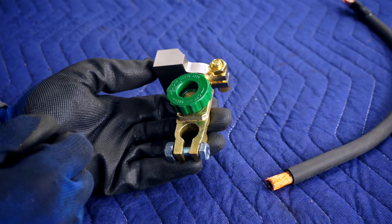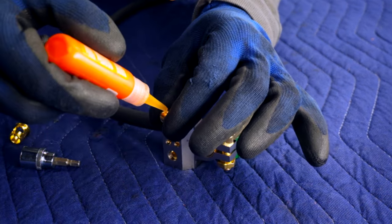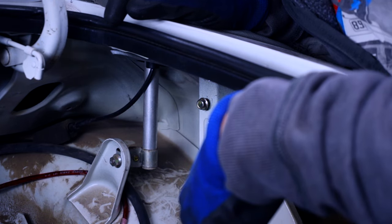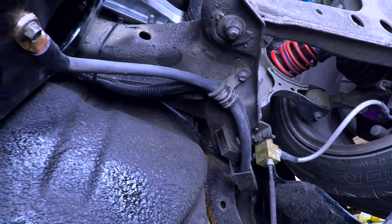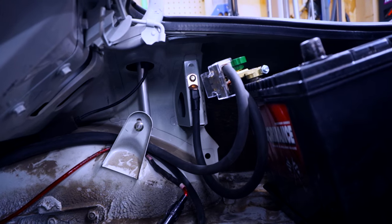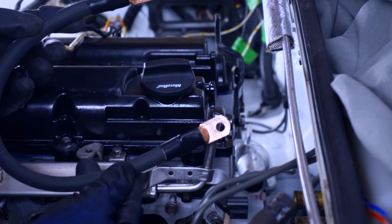On the negative battery post I've got this contraption — a battery cutoff. You turn this to the left to disconnect the circuit or right to reconnect it. And over here I've got another one of these battery terminal distribution blocks. Nice and secure. The other end will bolt to the chassis right here. Let's make one more that goes to the PPF. Here we have the new ground cable that goes to the PPF — it comes through the trunk floor and I routed it through the factory cable guides to the PPF right here. This cable thickness is probably really overkill, but a lot of electrical issues can be attributed to poor grounds, so this should prevent that. Back in the trunk we have the ground cables connected to the negative battery terminal block and the chassis ground connected right here. Using the last little scrap of cable, I crimped on a couple of lugs and we're going to use this as a grounding strap from the back of the cylinder head to the chassis.